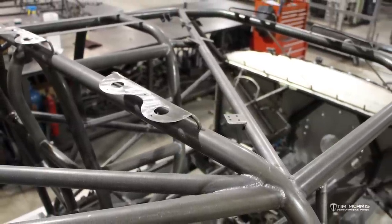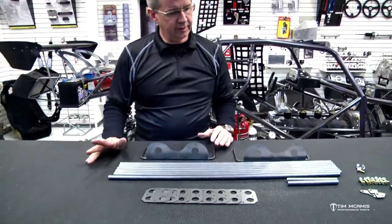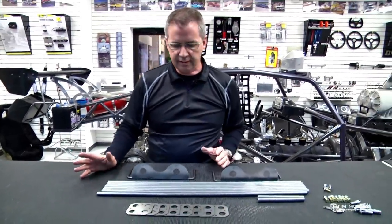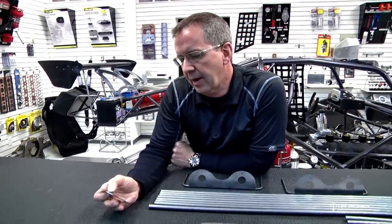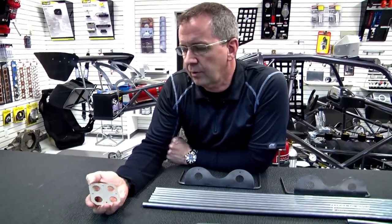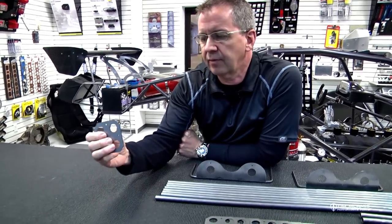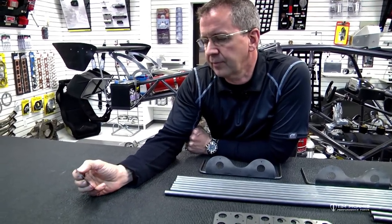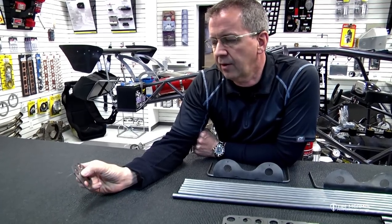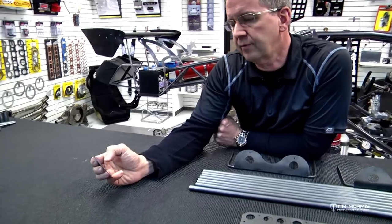We make the bodies mount on the chassis permanently, we don't make them removable. But then we have a kit we call a bolt-on kit. About ten years ago we were mounting these just like I was telling you with the weld-on method — we would drill holes in the body and then we would get inside there and tack fit the tubes and tack them on to this plate. A couple things happen there: you're drilling holes in the body and then tacking on this plate here and you have to put three or four tacks on it so when you take the body off it stays in place.